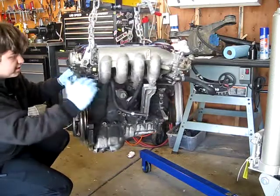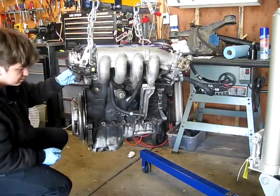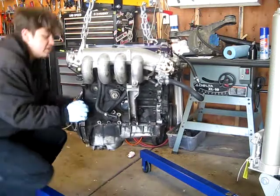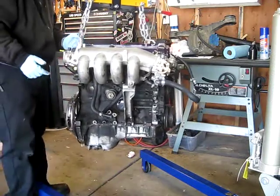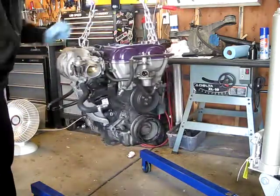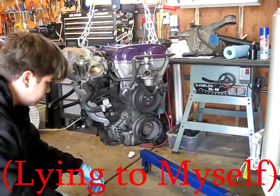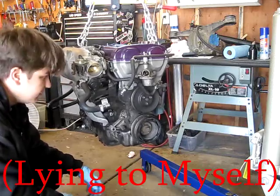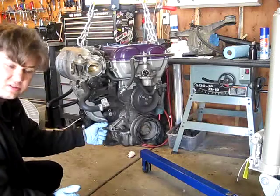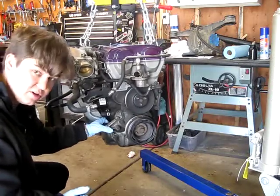While we're in here, we're going to do a coolant reroute, because I know those are a pain in the butt to do, but with the engine out it'll be kind of a piece of cake. I'm also going to do an intake manifold gasket and some general cleaning. Basically, the goal is to make sure it's not hemorrhaging fluids. The engine's in alright shape — it's pretty worn out, the piston rings are a little worn — but hopefully after this, everything won't be leaking so vigorously and we'll be ready for a turbo kit in the near future.